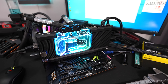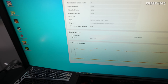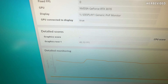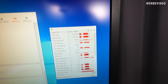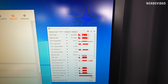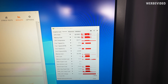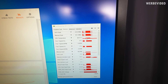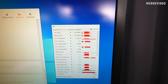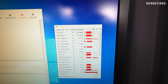After another loop test of TimeSpy Extreme, we had 43.9 before and now we have 45.1 — so there's definitely a performance increase. The reason we saw this increase is the higher clock speed: we went up from around 2010 to 2040 MHz without manually overclocking. It's just due to the boost from the lower temperature, which results in lower power draw. Temperatures are sitting at around 51–53°C — not the lowest I've ever seen on water cooling, but definitely a good improvement.